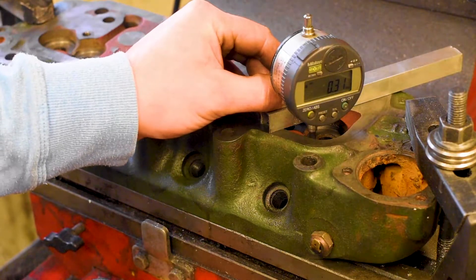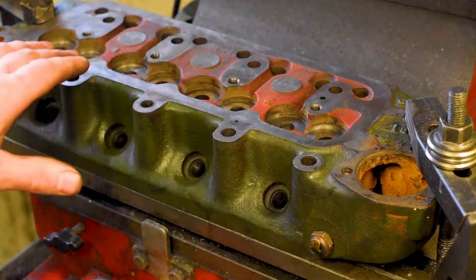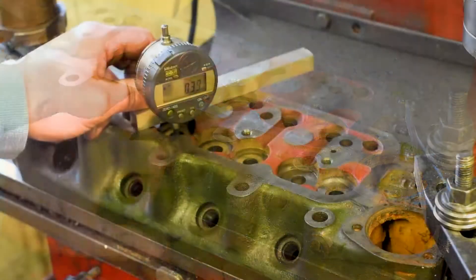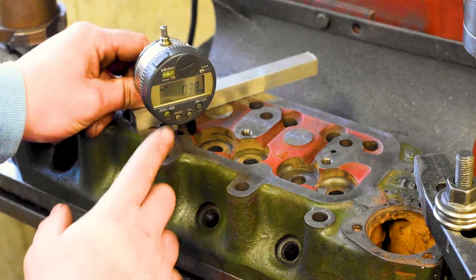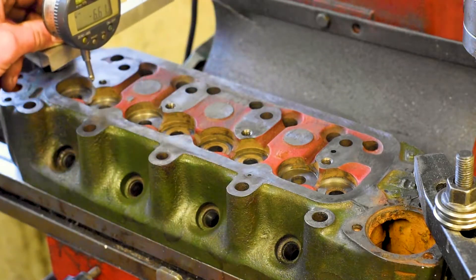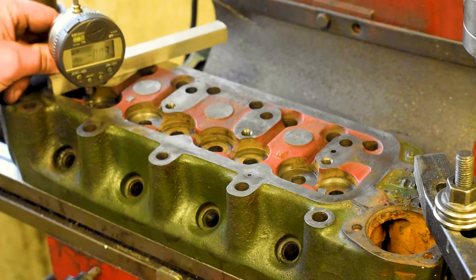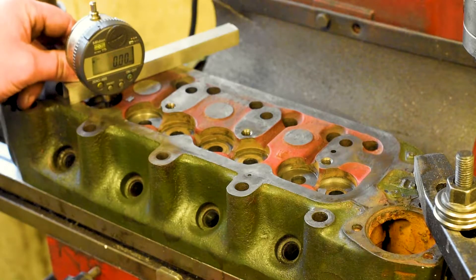Just to give you a look at some of the discrepancies here — this one is 0.4, so effectively half a millimeter higher than the factory setting. Now looking down here at one of the seats I have already done — I now have it at the factory setting. Hopefully you can see as I bring it into the indicator view, we're at zero. So that's the factory setting — that's the height it should be at.